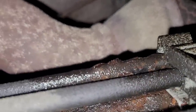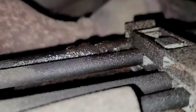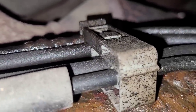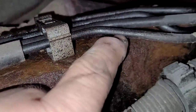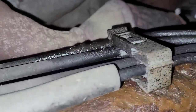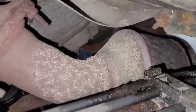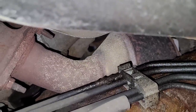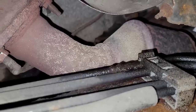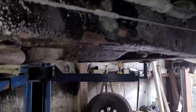I got the wheel well out and the wheels off too. This inside line actually goes to the right front wheel — that's the one that's leaking. The other ones actually look okay. At first I was thinking it rotted inside that clip, which I've seen before. But judging by the fact that I don't see any swelling on the other ones, I think they're okay. The reason these lines are black is a coating to help prevent them from rotting out. But notice how close it is to the catalytic converter.